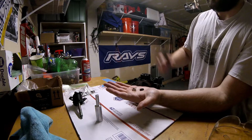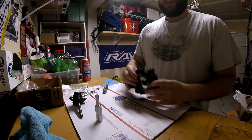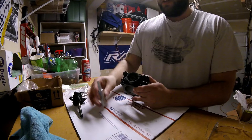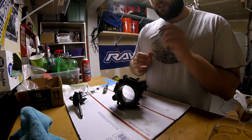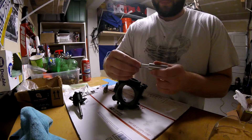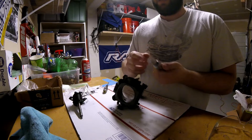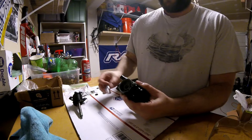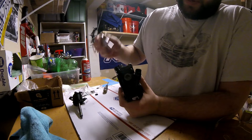I had to wait on some stuff so I ordered these anyway. One thing that's troublesome about doing these seals is that when you go to install them, sometimes you use a socket or a handle or something to push them in. Well, someone came up with a really cool tool to help support the seal as you're installing it so it can't go in crooked, bend, or get caught. It basically supports it all the way through the shaft — you just tap on the head and tap it all the way down. It's CNC milled. I already have one in on this side, so you can see the mil-spec seal is in.